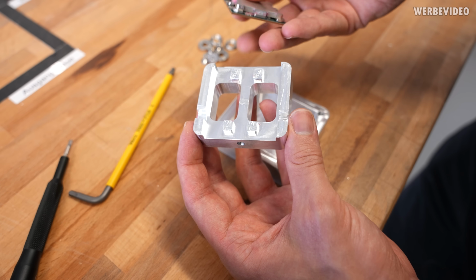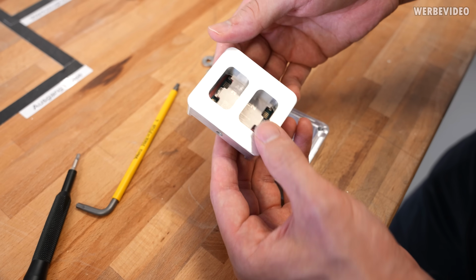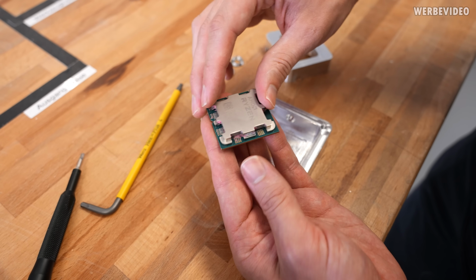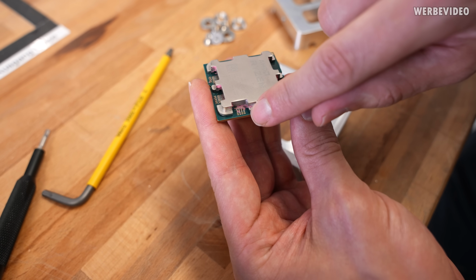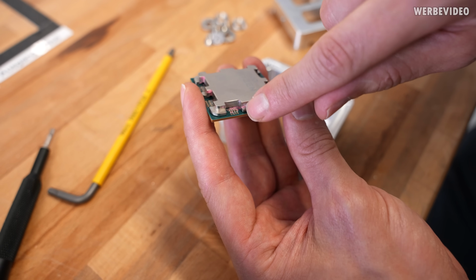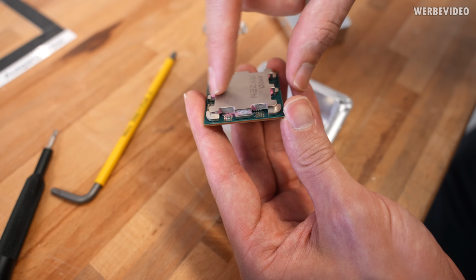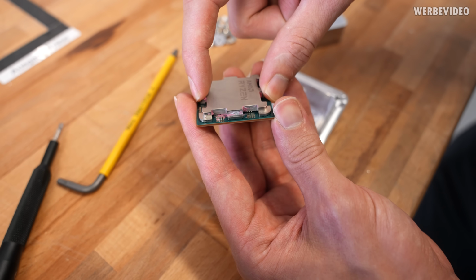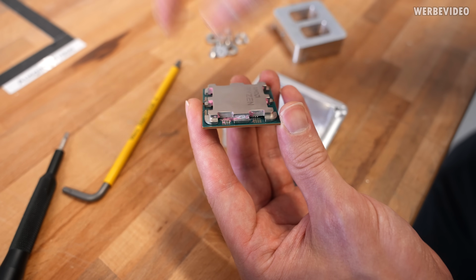The plan is that basically the slider fits onto the AMD Ryzen CPU, and then we will use the slider to push the IHS slightly back and forth, left and right. Because if you just check here, there is a space of about, or clearance of about 1.8 to maybe 2 millimeters, and that should be sufficient to just move it a little bit to left and right, and after maybe 10, 15, 20 movements, the IHS hopefully comes loose without damaging any of the other parts.